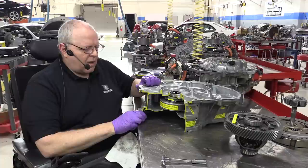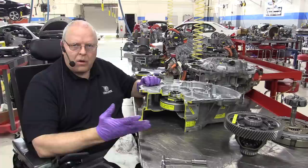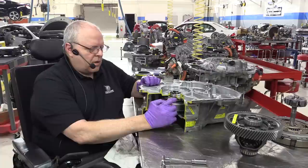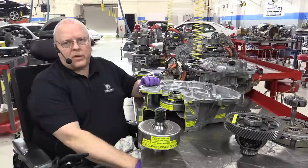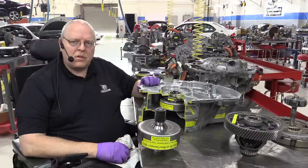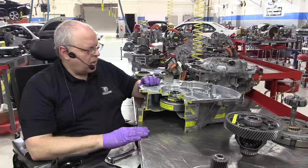Of course, we've got the rotor, MG1 rotor here. MG1 stands for motor generator number one, which is our starter and generator. It starts the internal combustion engine. It provides power to MG2 right here to help move the vehicle down the road, and any excess power is routed to the 201.6 volt battery, same as in the second generation Prius, in the back of the vehicle. It's a nickel metal hydride battery.